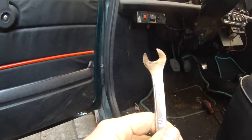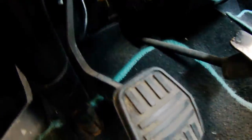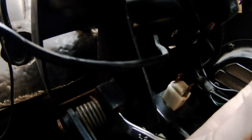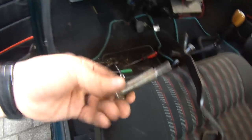This is a really cheap set that I had so I didn't mind grinding it down, and there are a lot of uses for having a thin wrench set. Up here you can see there's some left and right wiggle room for the brake pedal, and if you look up here there's a gap in between where it meets. I took my wrench and I've already undone it one turn, but it fits right up in there on that nut. Now I'm just loosening it up — and that worked.